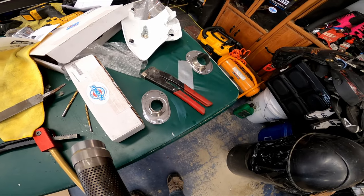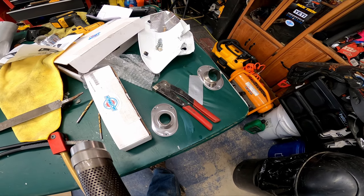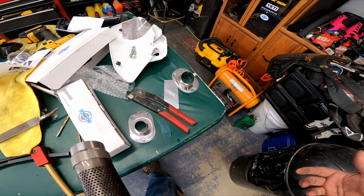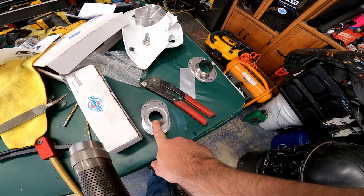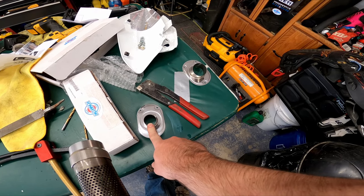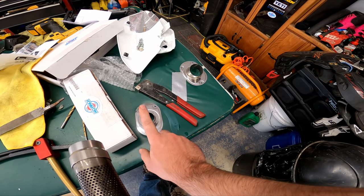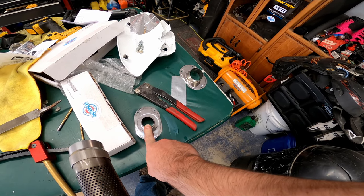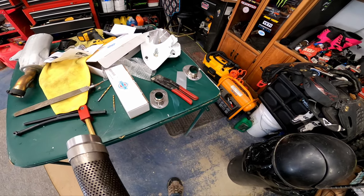Now, one of the things about the 150R is the carburetor is really, really jetted for upper RPMs. Like it wants to be running way up there. Down low, it's very cold blooded. Can even bog a little bit. I'm hoping that a little bit of restriction of the smaller one might clean up his bottom end for him, if I'm thinking about it right. I could be thinking about that completely wrong, but we're gonna see how this works. If we get a little better sound, a little better down low torque with the extra back pressure, that will be good.